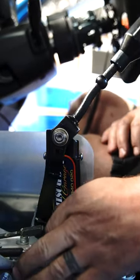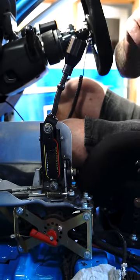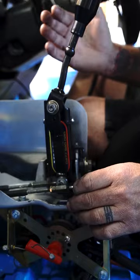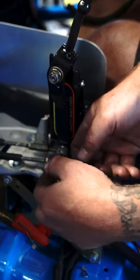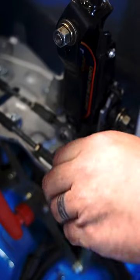Now once that's all tight, you'll see that we'll set this cable on to the actual shifter there. There are a couple of simple adjustments here with the actual cables themselves before we even look at adjusting the shifter or the stoppers. What we want to do is make sure that the cables haven't been adjusted previously, or maybe they're a bit worn. So we're going to take these little clips out — easiest way to get them out, just stretch that top, unhook it, and out she comes. We're going to pull this cable off. What we want to see is when we push this shifter side to side and we find its neutral position, we want to be able to push this cable on without having to move the shifter to do it. So this one here is slightly out. I've already loosened these two locking nuts off, and quite simply what we do is hold that and turn this middle nut here, which is the adjuster. We can twist that and it'll make it longer or shorter. Find your desired length where it just slides straight onto there — as you can see, it slides straight on without any issue.